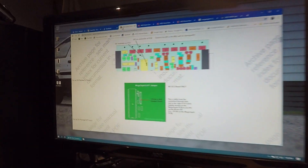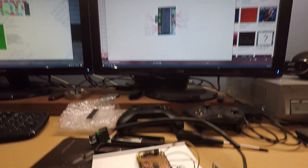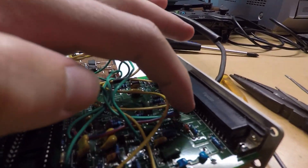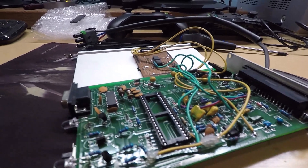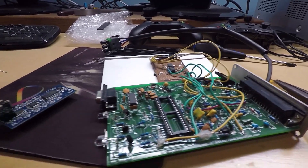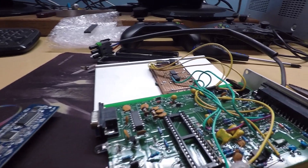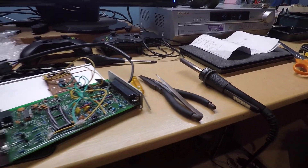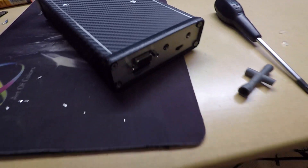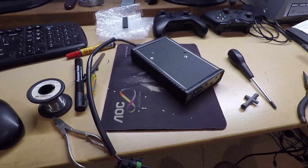I've just done what it said for the MS2 — it requires some extra wiring in the form of a red wire that runs here. It's actually picking up a 12-volt source from the engine bay and bringing it back to the ECU chip. That allows it to do table switching, which I already had on the MS1, but the MS2 just runs it a little bit differently so you have to run that wire. Soldering iron out. It's a bit of a tight squeeze but it's all back in there — MS2 chip is in.